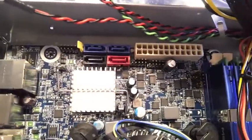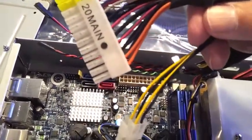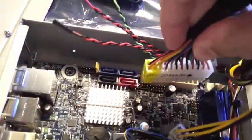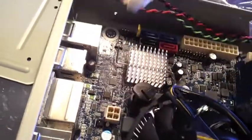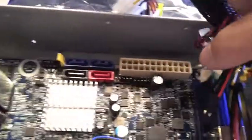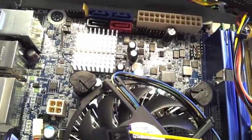We're going to put in the 4 screws and then prepare our cables for where they're going to go. Here are the main wiring harnesses from the power supply that we're running along the side. This part here is going to go there. We're then going to take this lead here, and it will go over here. The 3 leads that we reran here will end up plugging into these little colored attachments down in there, right through here. And then on the opposite side, we'll be attaching the extra fan lead here to this red connector here. So I'll attach the 4 screws, cable in the leads, and be right back.